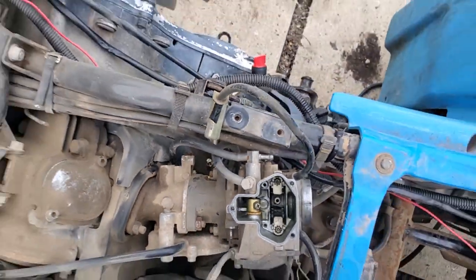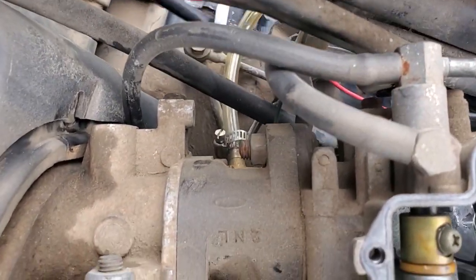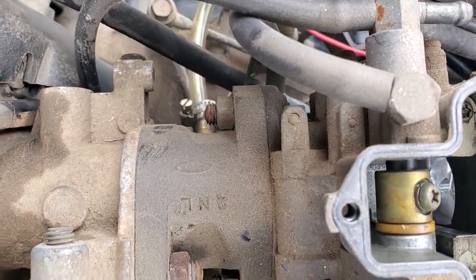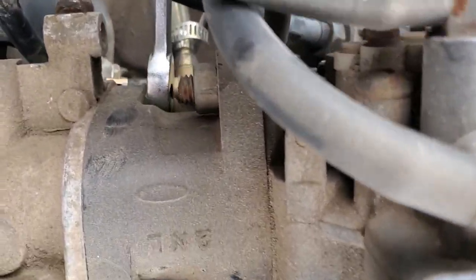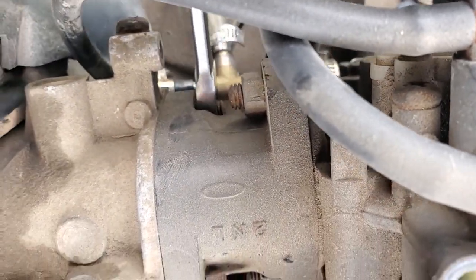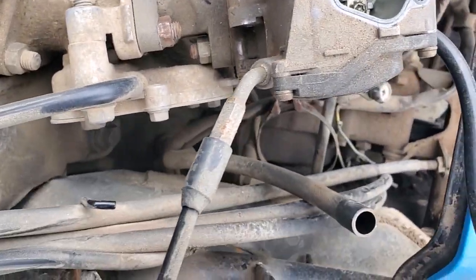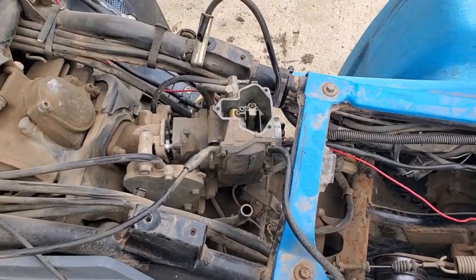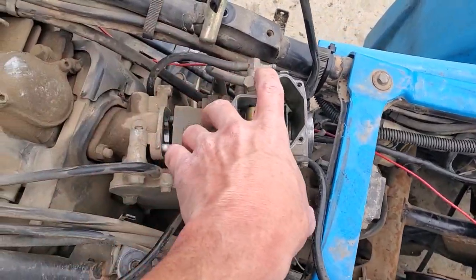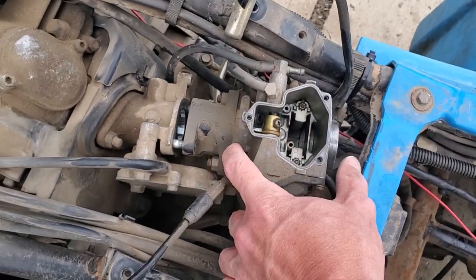Right here where we're at we're going to come in the side. Grab hold — about two spins with just this and this is loose enough for your fingers. Okay, let me take these off. Now those two screws are off and the carb is going to pull out.